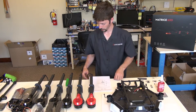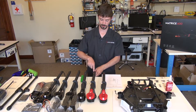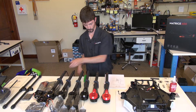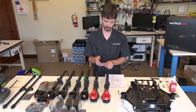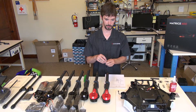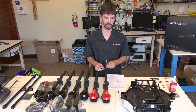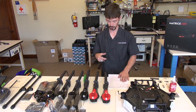I'm going to start off with my number one boom here. You can start by pulling out the cables inside the booms — they're just kind of wrapped up and pushed inside for shipping, so you can pull those out. On the ends of the wires, you'll find some cellophane shrink wrap that holds the connector together and keeps it all tidy. Hold off on taking this plastic off until you get it snaked through the copter itself and up to the distribution board. It just makes it a little bit easier handling one set of wires rather than a couple just kind of being loose, so leave that.